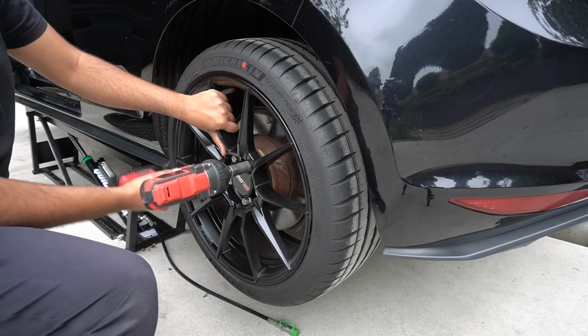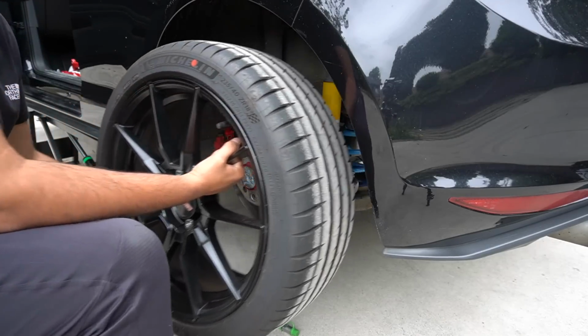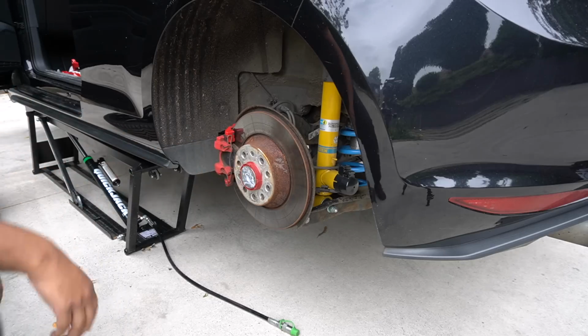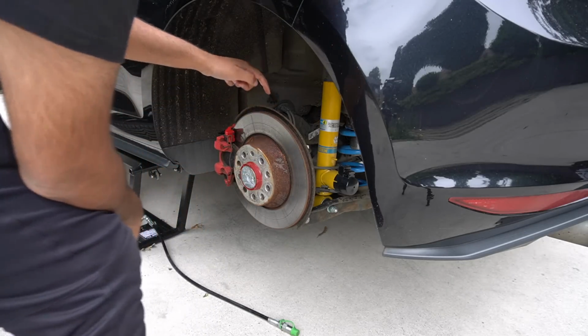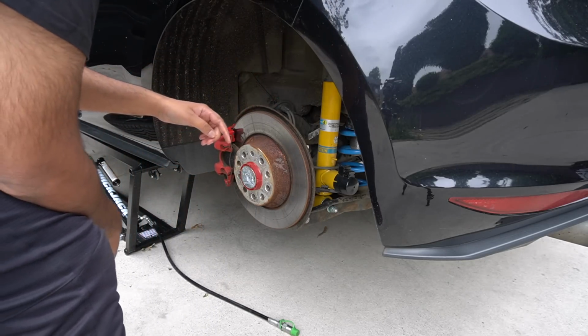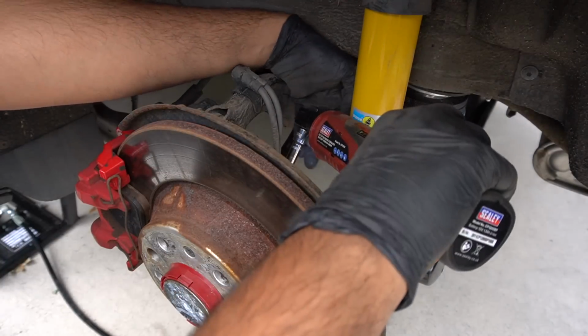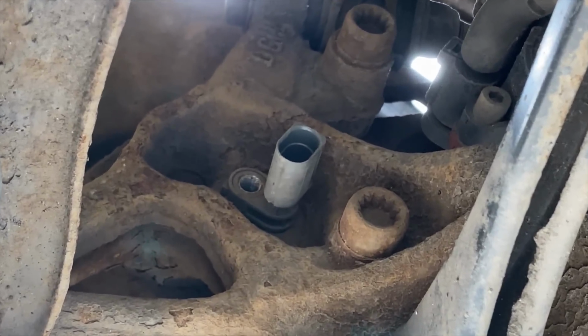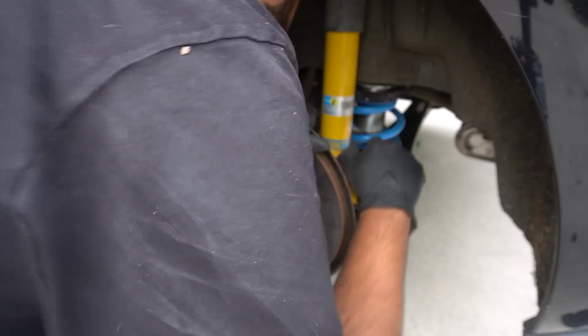First things first, wheel off. Pretty stuck on there. Okay, the spigot rings come off as well. Right, we'll leave that there because I'm going to have to put it back on anyway. So the wheel speed sensor is behind there. There's a T30. Right, so that's loosened there. You probably could just see my arm here, but it's quite a straightforward job really. There's a VAG style connector on it and a T30 holding the bracket on.